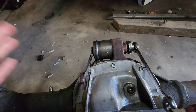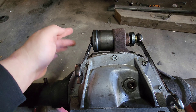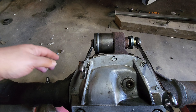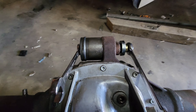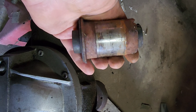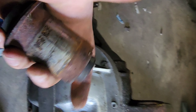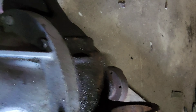I'm going to get this out, then pressure wash it, degrease it, and give it a paint job. Got it all set up ready to remove — just tightening it up pulls it through the cup. Basic tool, pretty cool. If you have this tool and need the longer bolt, it is a 7/16 grade 8 bolt, six inches long. Home Depot didn't even have any 7/16. You'll get to a point where the tool is a little too short — I just used a chisel and hammer, caught it on the lip, and knocked it right out.